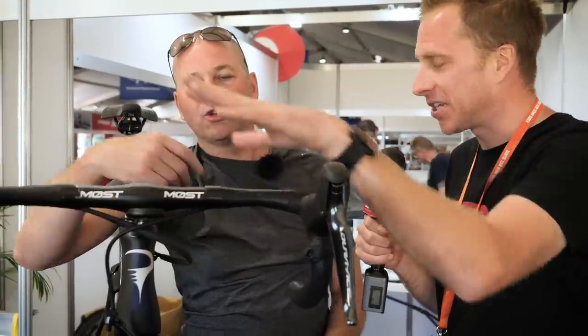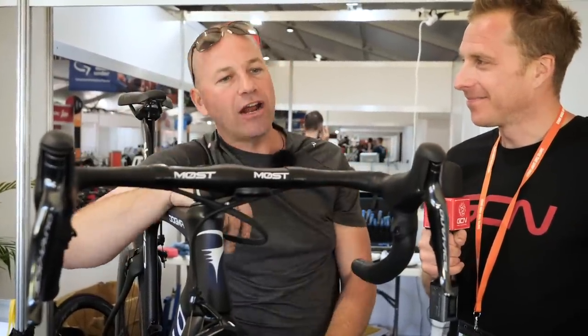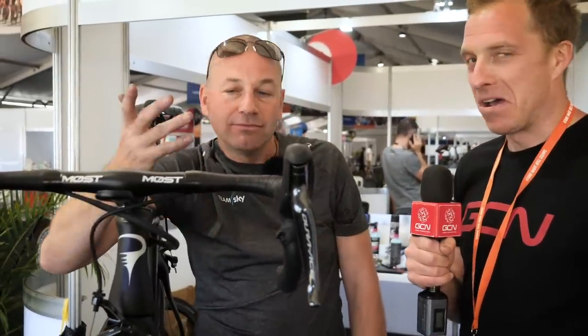When you used to work with people, you would check that they had cut equal amounts of remainder tape from each side — because obviously you have more bar tape than you need. I always say the best bar wrapping job means both of those leftover pieces should be equal length at the end. Working in a bike shop I'd torture new guys with that. You'd get the new guy where one side is thick with cork tape and the other is super thin, like he's got one T-Rex arm and one strong arm. They've got to match when you cut your remainder pieces off.